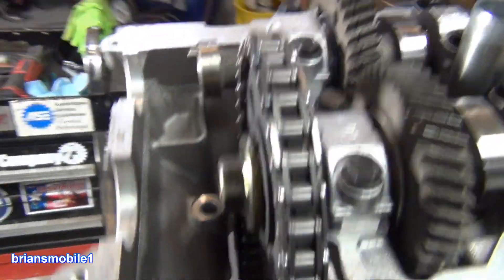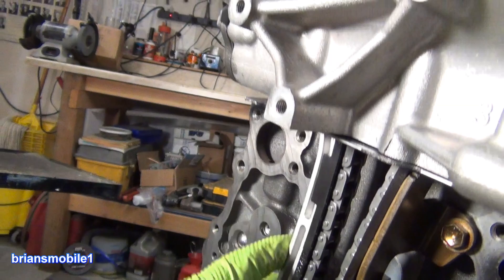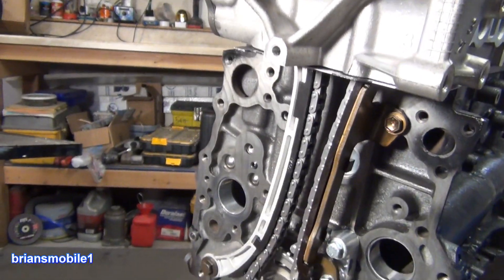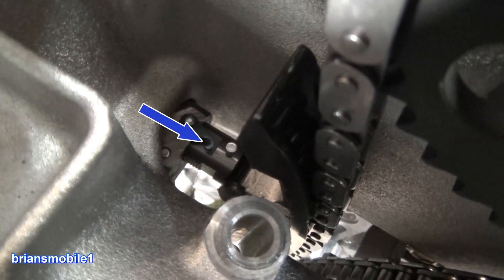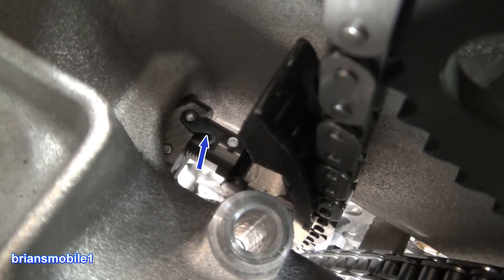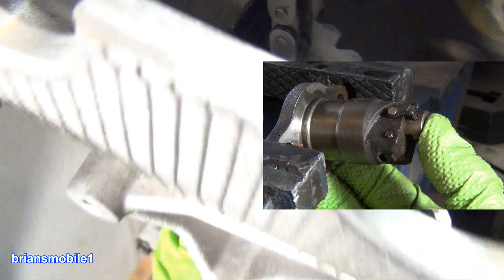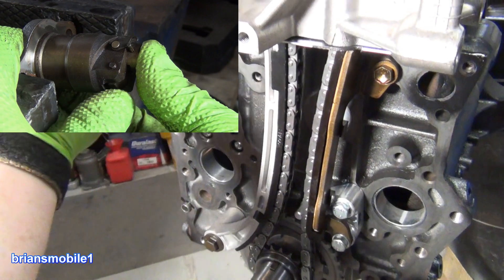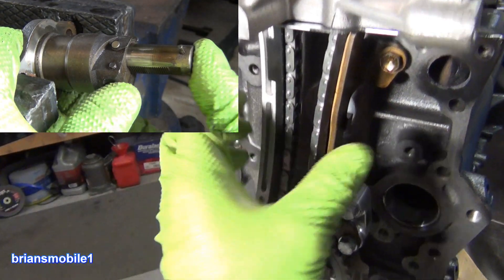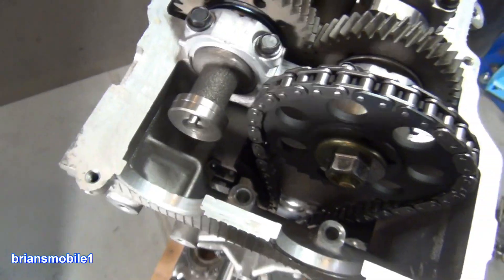You bring up most all of the slack with this tensioner guide here first, and then this one is the one that brings up the rest of the tension. To release the tensioner you can see there's a little pin and a hook — it's kind of spring-loaded and you can see the slope right here. If you push on the tensioner to tighten it, it will be floppy when your tensioner is out. You put the new tensioner in with it retained, then you push against it this way first and it'll release and tighten in.